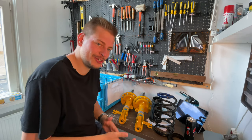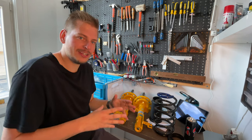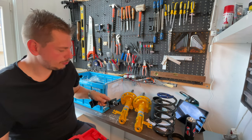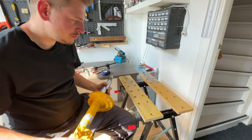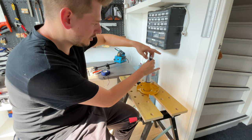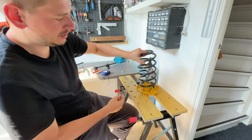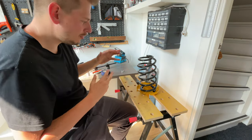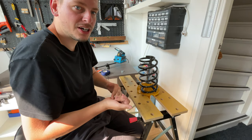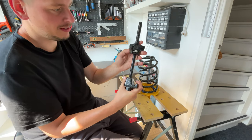I did look at a lot of YouTube videos to see how it's supposed to work. I also bought a spring compressor kit that seems fairly secure — I didn't buy the absolute cheapest. It has locking pins which should theoretically hold the springs in place. First, it helps quite a bit to have a level surface, so I'm clamping it on a Workmate. Next, remove the top nut and washer, making sure the spring end sits in the correct indentation. When compressing the spring at home, please be incredibly careful — use the security pins.